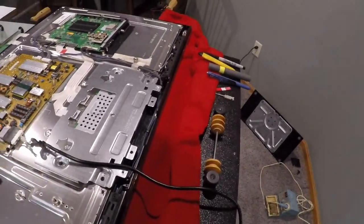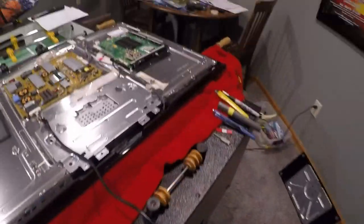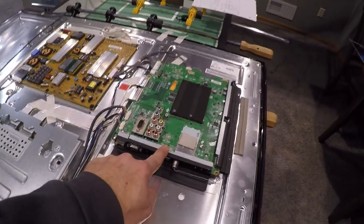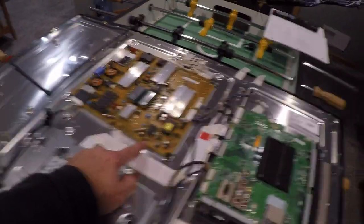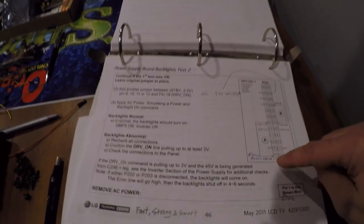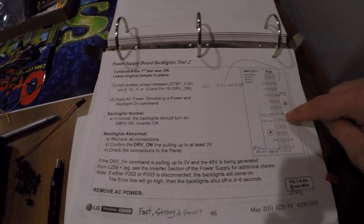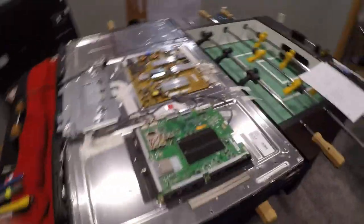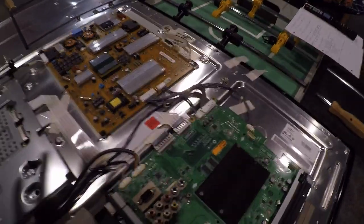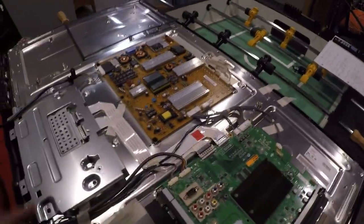But the backlight LED didn't turn on. I was able to find a service manual for the TV and a schematic for the main board here. I never did find a schematic for the power supply, but you don't really need it. The service manual does a really good job. One of the things the service manual tells you is if you take the power supply cable off the main board and short two pins — a power-on pin and a LED drive-on pin — so I removed this cable here and shorted two pins with a piece of wire. I could see the backlight come on bright, so I knew the power supply was working.